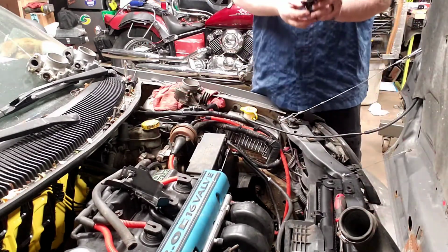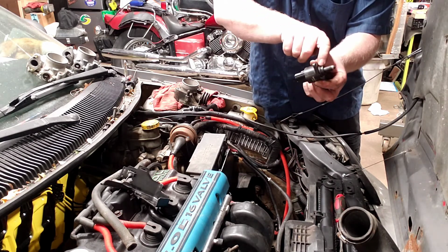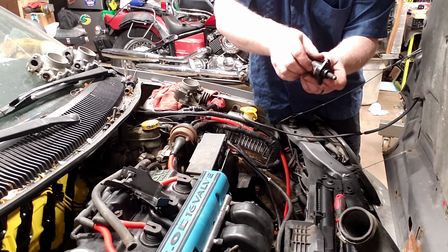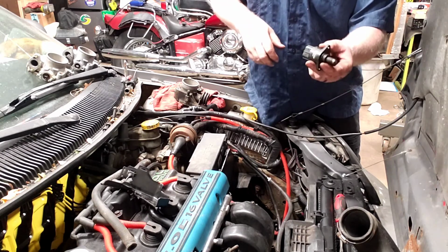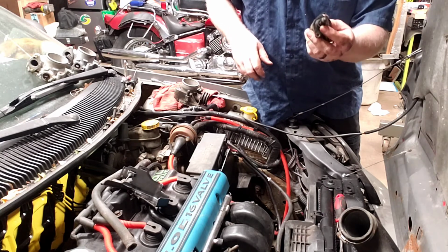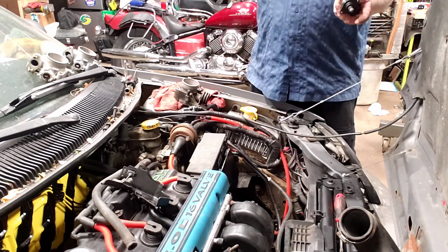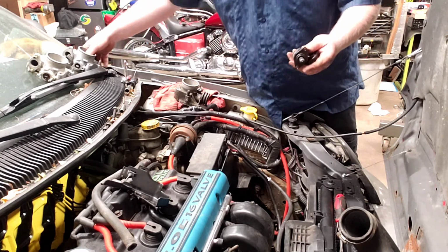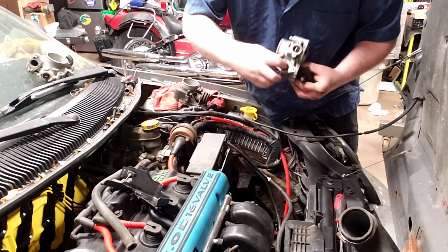Alright, so I have the sensors replaced here. You'll want to note that there is actually an O-ring that helps seal up the idle air control valve against the body of the throttle body. If that's not there, you will have a vacuum leak, and you will have inconsistent or high idles as a result. Now, of course, you're using a junkyard throttle body, most likely. You do want to make sure you clean things up ahead of time. This one I've already cleaned up somewhat.